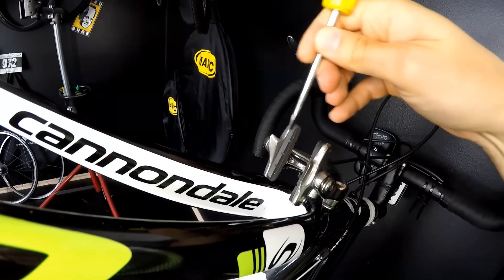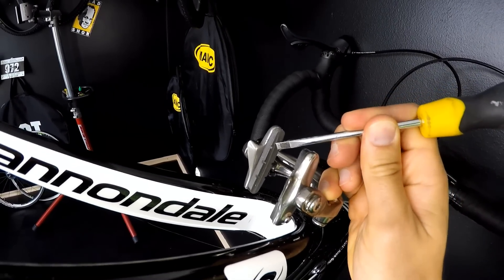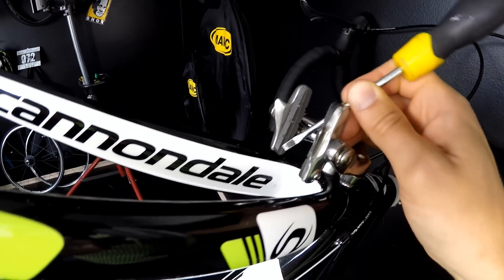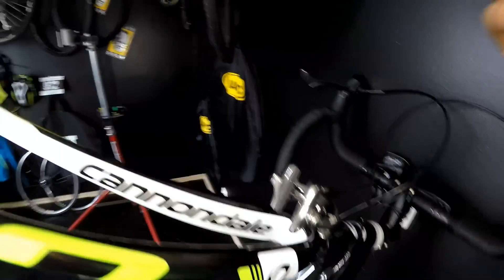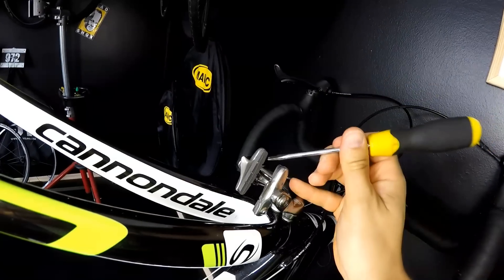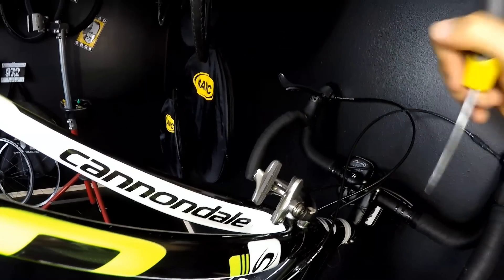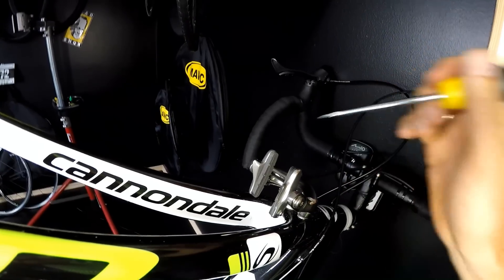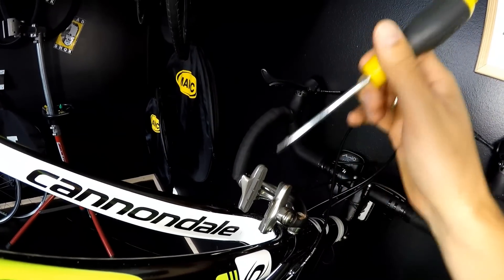The rim is off and you can see those braking pads don't look very good. I still have plenty of material on them, but you can see those little parts of metal that have been taken from the rim — it's on both sides. It depends on the material of the rim and also on the braking pads. On my other bike where I'm still running V brakes, I just use a sharp object to take out those little metal parts and it works fine. But for these Ultegra wheels it's just not enough — there should only be rubber from the braking pads, nothing else.